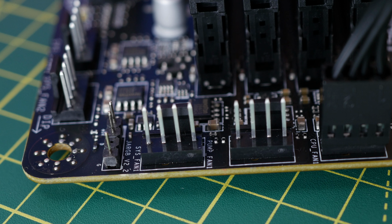So I'm going to show you some different options, because this will be useful depending on how many fans you're using. You can see I've got quite a few fans here, for example. If you have more than that, you may have even more considerations. Now, with these fans, you plug in the 5-volt RGB cable to the 5-volt header on your motherboard, and then the other cable into a system fan header or chassis fan header on your motherboard. And then, obviously, you just repeat that process for all the fans you're planning on connecting.